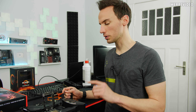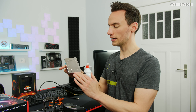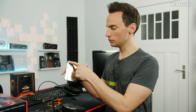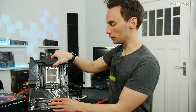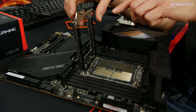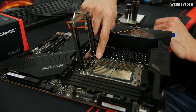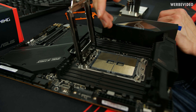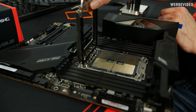While we're waiting for the CPU to be ready for delidding, let's take a quick look at the cooler and mainboard, because these are crucial parts for direct die. First, we needed a cooler that is really flat on the bottom — that's why I picked the Watercool Heatkiller. It's really flat, none of the screws are standing out, and the holes don't collide with the mounting holes on the socket. The socket is also quite problematic — we'll have to remove both frames and also the whole mechanism sitting on the bottom, because all of this is too high. The CPU cores themselves won't sit much higher than the plastic frame corner, so everything higher than that will collide with the CPU cooler. That's why we have to completely remove this — first step is removing the four screws on the corner of the socket and removing the frame.